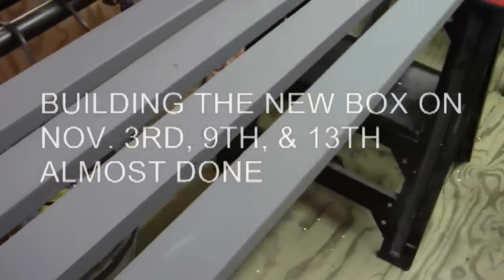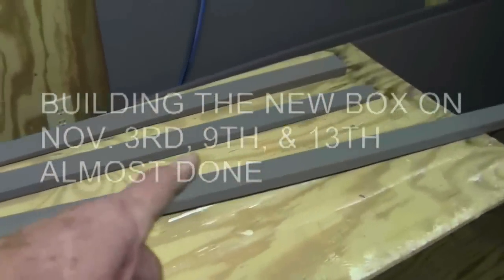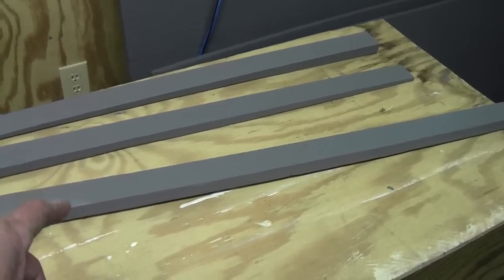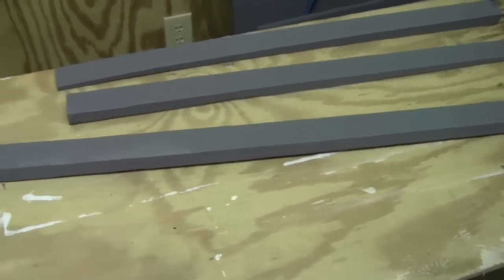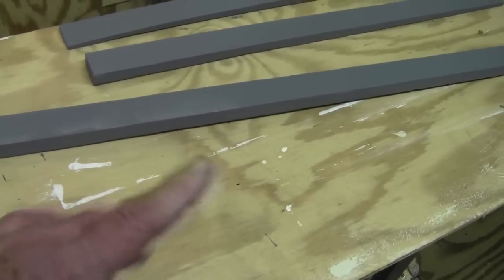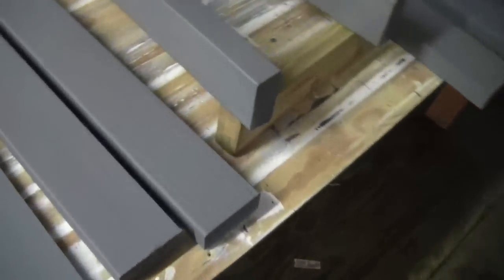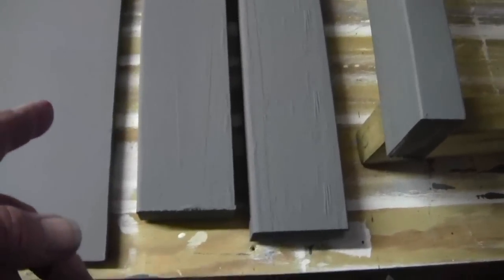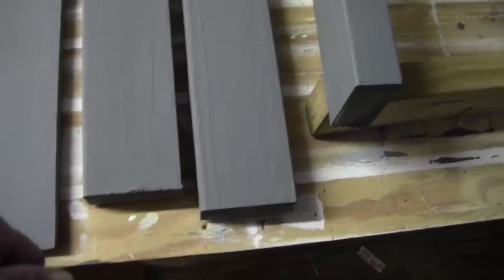It's nice to have all this wood double coated. These are the two wedges that are going to go under the back and be mounted on the box itself, so it will sit flat on the trailer. Where the tailgate goes you need one, not quite 48 inches long, to support it across the back of the trailer. All these are painted doubled — the ends have four coats of primer and paint.